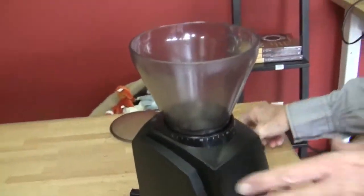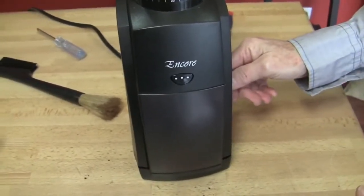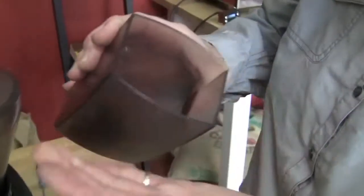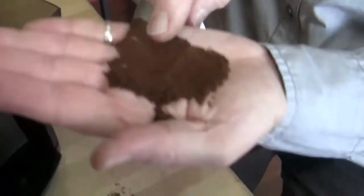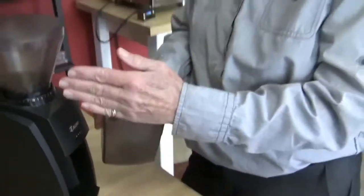Here's that micro switch making its noise. I'll get some beans. Switch back on. Let's see what she does. It's clumping even a little bit — feel that. It's way powdery, way powderier. And that's down at the one notch up from zero. That's about as low as it went last time. You can see that's much finer — considerably. Yeah, you could use this for espresso. So if you pick yourself up an Encore, take it to the finest, and it's not working for your espresso machine — calibrate it, follow this process, and you should be good to go.